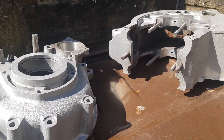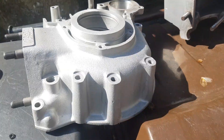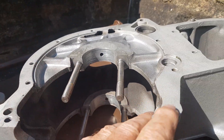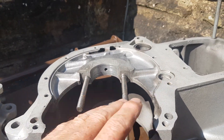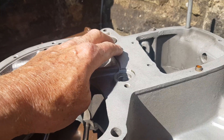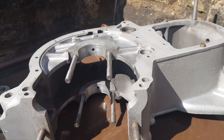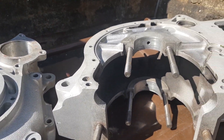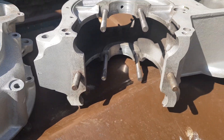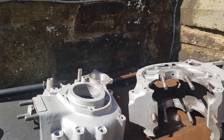I've given them a really good clear out and I'm glad I did, because it's amazing how much crud still came out. Can you see all this grit on here? That's what's come out after I've already washed everything. So it's so important to get those oilways clear. I've also given all the threads a quick blast out as well. I will be checking them with a tap later on because vapor blasting can really damage these threads. I've done all the threads on the cases and I'll do the same with the other cases.